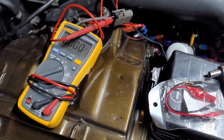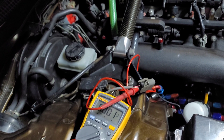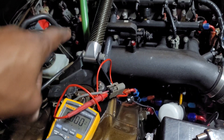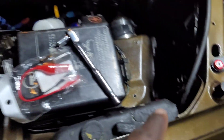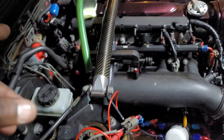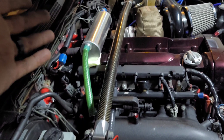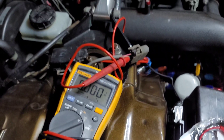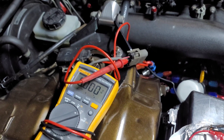I'm going to set it to 0.48V and then set it on the Link ECU. I'm in the market for a catch can — I kind of want to keep this space open, or maybe I'll just keep using this one. Either way, let's set this throttle position sensor real quick — I'll throw it on, check it, and go from there.